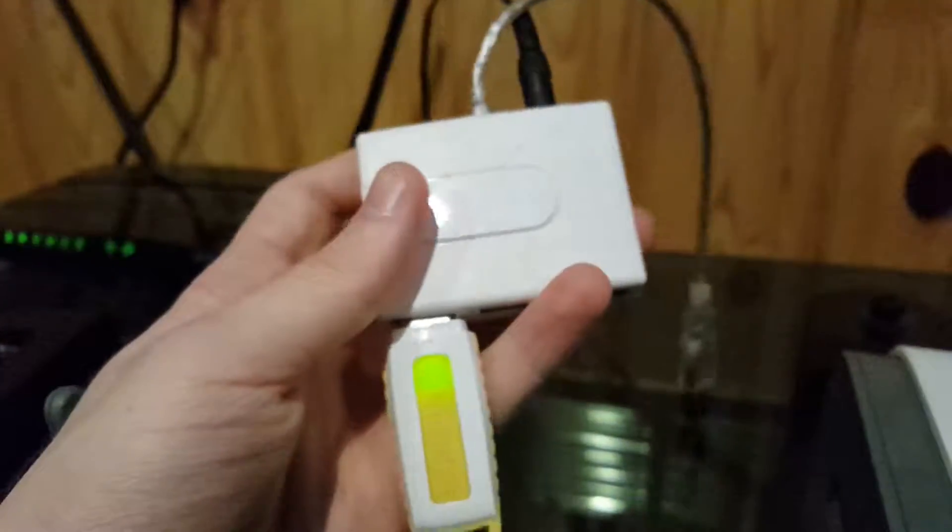As you can see, I've got my USB flash drive plugged into it and it is getting power, working just fine. If I plug this into the back USB port here, you can watch the light on the WiFi adapter — it's probably going to flash about 6 or 7 times. What we're looking for is for it to stay solid green, because before it was just flashing. There we go — it shows all the networks, and it is now solid green. It's not restarting anymore, it's just solid green and showing all the networks.